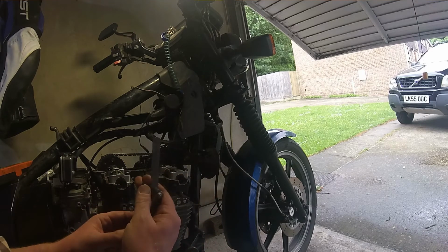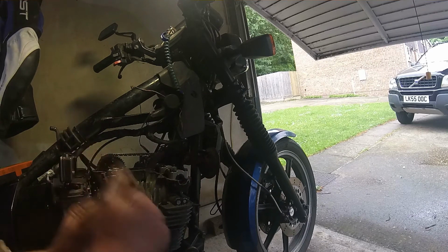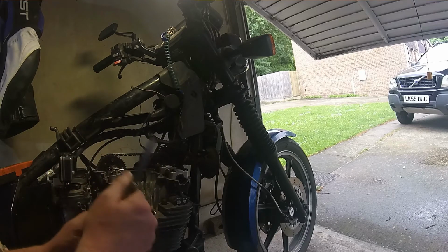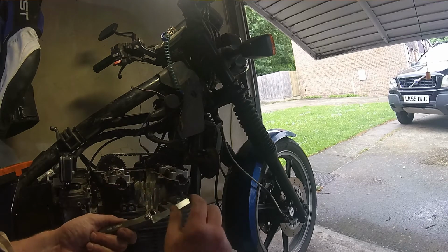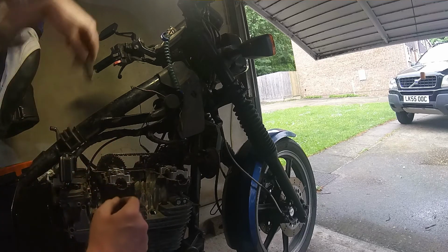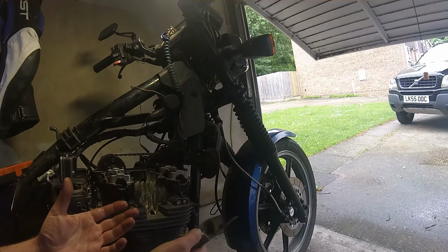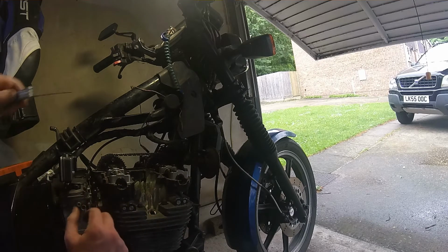And they are, the cheap ones are accurate enough, considering you're working to within a tolerance range on these valve clearances, that if you've got poor access, there's nothing wrong with buying a cheap set and bending them. So what I did on the Fireblade, I had a set of these that were bent here, much longer feeler gauges, but bent at the tip, so I can get in and get the feeler gauge ends in. It took me a little while to heat them up and bend them successfully, but you need to get in there properly, and you need to feel confident that you're getting it right.